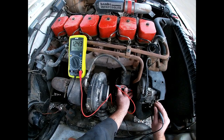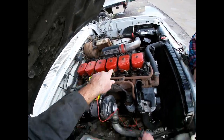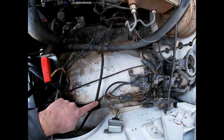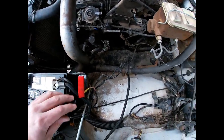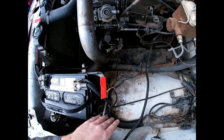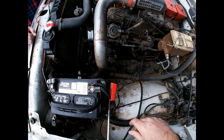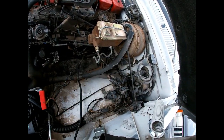The second lug you will not have battery voltage at until you turn the key. If you test there and you don't have anything, you need to trace the cable back — it comes through here, runs along the firewall, loops back on itself right here, and then comes over to the battery. If you don't have power at that lug, something between here and there broke. There are a couple of fusible links in here that can burn out. If you're having issues with that, you can just get a nice new thick-gauge battery cable and run it over however you want.